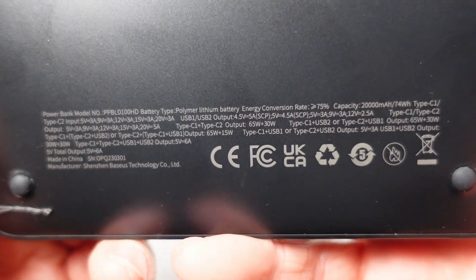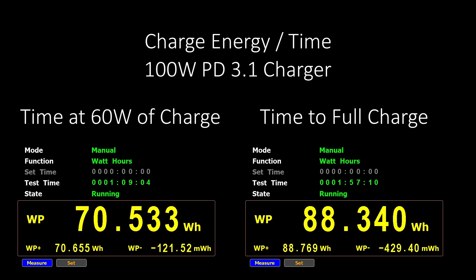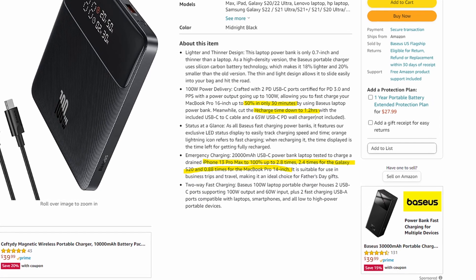We have the battery capacity of 74 rated watt-hours. I measured the output capacity at 67 watt-hours. With the losses for converting the voltage to the output, you end up with about 91% of the stored energy being sent to the output — this is the best I have seen. The charging on this power bank, which tops out at 60 watts, was great, so the overall system efficiency ends up at 76%, which means this is also the best power bank out there in terms of energy from the wall to energy delivered to your device. Charging time ended up being about 2 hours total.